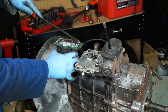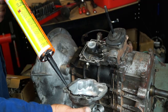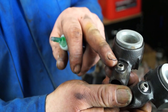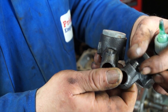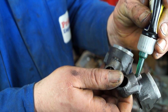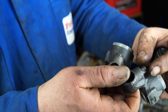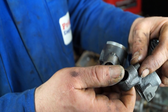Clean off the old gasket. If you want to use a gasket you'll need to order one separately as it's not in the kit, or use black RTV silicone which is probably best for the job. The grub screw needs thread lock — use a bolt lock or stud lock, not a nut lock. This dries quite hard; one I prepared earlier was almost impossible to undo, which is ideal.